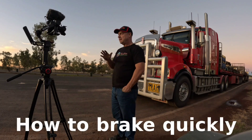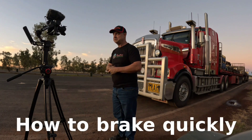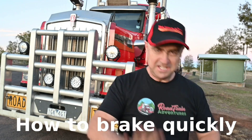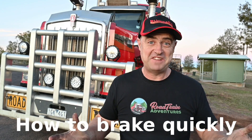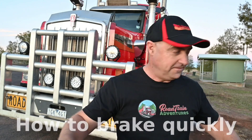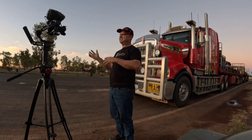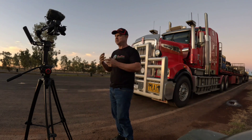Next point: if you're driving along and you need to stop suddenly, the first thing to get into your mind is not to lock the brakes up. It might be your first reaction to jump on the brakes, but if you do lock up — during the day you can see it because of the smoke — you need to let go of the brakes and reapply. You'll stop a lot quicker than if you just jam on the brakes and hold it flat to the floor with everything locked up. Once you've lost traction, you just keep going.